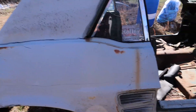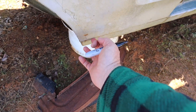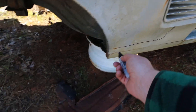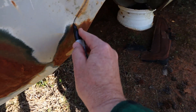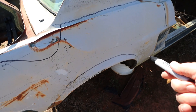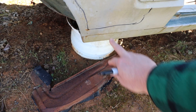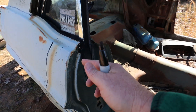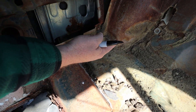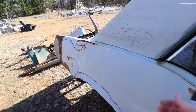What I would do with this rear quarter is come in here and cut it back here like that, cut that down. Don't cut through your rocker panel, but I'll probably come all the way down like this. We've already pulled the vents out. I'm going to cut right down through here and cut up and around — give myself a bunch of access space — and cut that off. So the whole quarter panel is going to come off. Then I'm going to work with this stuff individually, loosening these pieces from the inner wheel housing. On the inside there are spot welds — you'll be able to see them once you cut this out. You've got to get the rear quarter loose from here; there are spot welds down through here, and spot welds inside here. You have to get all those loose and just work your way out, getting all this metal off.